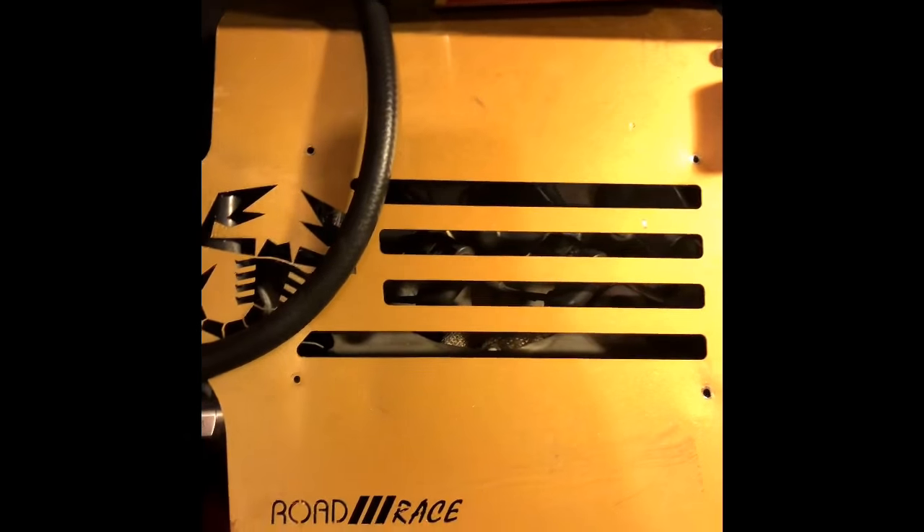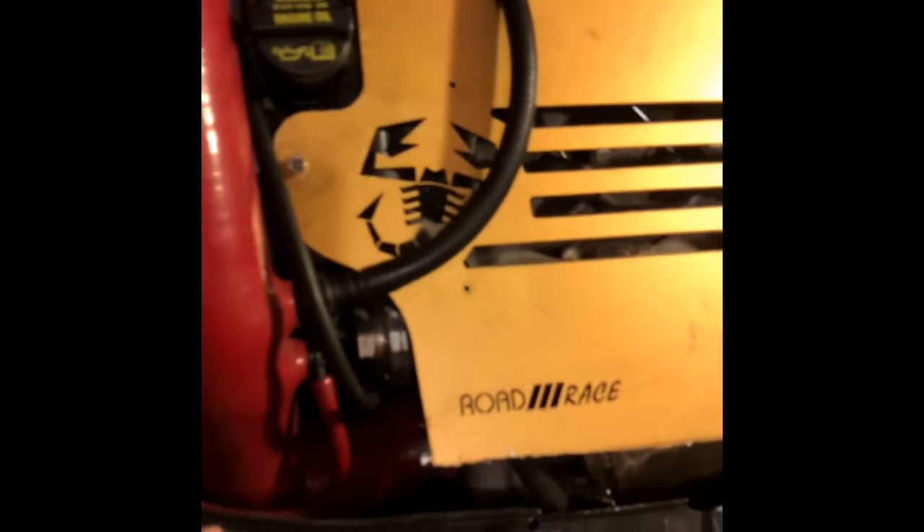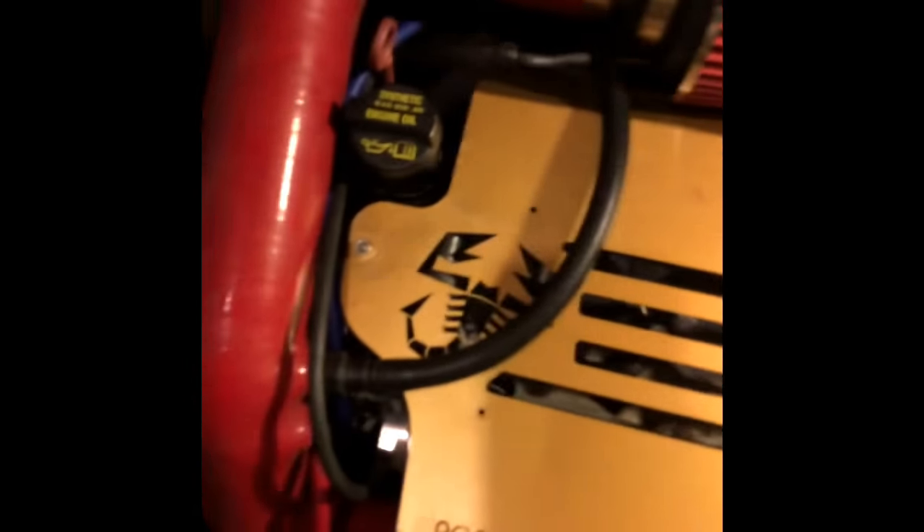I am running their boost leak fix, so that's why this one's kind of over here — I didn't really want to place it under there because I don't want to crack any hose with the high temperatures. I am running the 4C coils. It says 4C coils, HKS blow-off valve — you can barely see it right there, sorry there's not enough light. This turbo I'm running does not have a connection like the stock turbo does where it's on the turbo, so that's why I had to run a different blow-off valve.